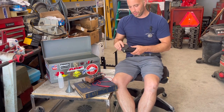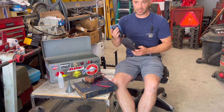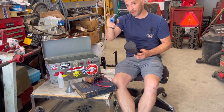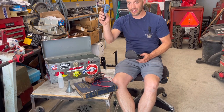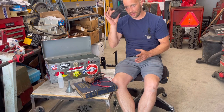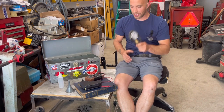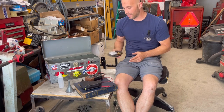Here's a handy dandy tool — this here is a portable digital tachometer. If something was happening to that tach or something wasn't reading right, or if someone gives you a distributor that's not 100%, this here — you put a little strip of tape on the wheel that comes with this kit on the harmonic balancer, hit it, and it's going to tell you how many RPMs it's turning. It's always good to have a backup. If something goes wrong and something fails, you've got a compression tester. This we've never had to use — knock on wood, hopefully never have to.